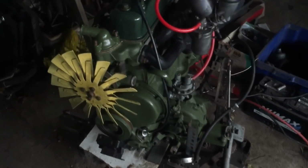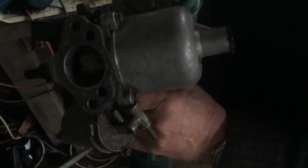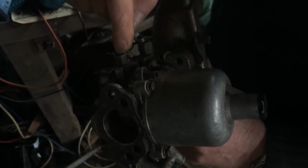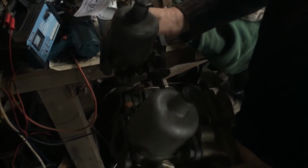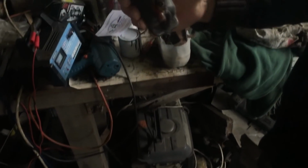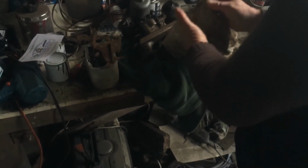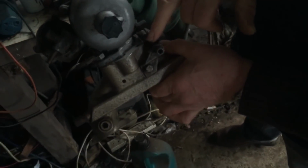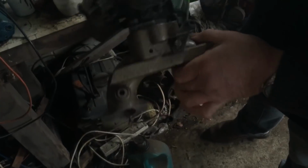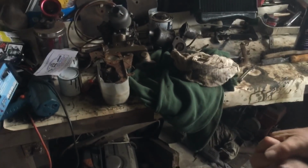Let's pencil in hopefully the last weekend of January or something like that, or during the week. I bought that off, and I thought that's a one-off twin carb setup. Oh, okay, because I saw this here. And this here, and I've actually got another big old 1.5 inch, which is the opposite hand. That's off a Marina, so that'll make a pair. So all I've got to look out for is a manifold. For 1.5 inch, they need the slanting. A lot of the later manifolds do both, but the early twins for the 1.5 inches were just angled.